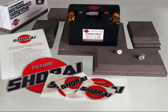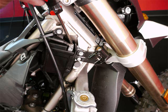Your user guide, included with every battery, lists the contents of the package. Check now to be sure everything is there. To get started, first we'll remove the original lead-acid battery from your vehicle according to the maker's guidelines. Be sure to remove the negative terminal bolts and cables first and secure the cables, then the positive. That avoids the possibility of shorting from positive to grounded vehicle parts.